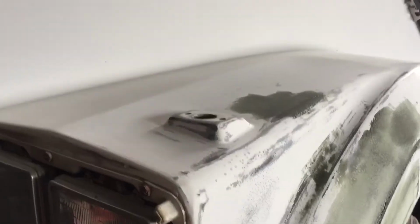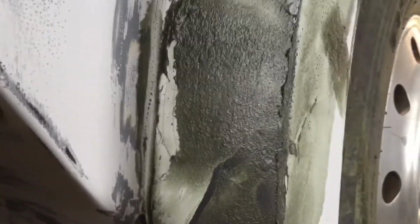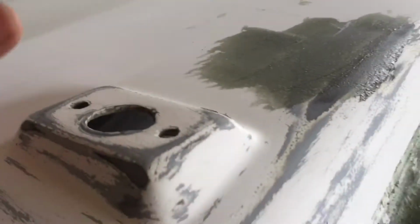I just finished mixing the Bondo Glass. Spread it. I did it from up there, just evenly, quotation marks. And then to here, I just smacked a dab. Anyway, it's gonna be sanded down to see where, like I said, the highs and lows are. And I just added some up here, some there, places where it was cracked and whatnot. This edge, I tried to have like the body line, and I'm just gonna see how that turns out.